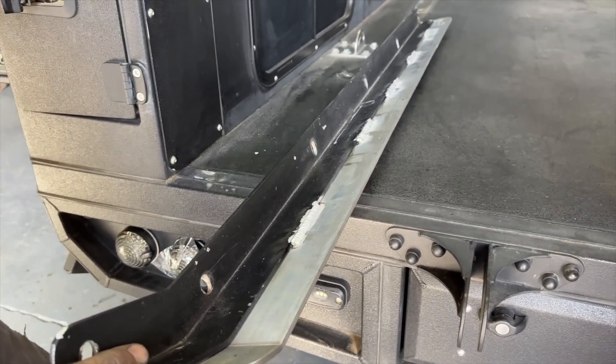Today we're in the Victitech workshop. While the guys are doing a bit of maintenance to the build, I took the opportunity — we're back in Cape Town where I can get all the Land Rover parts — to do our brake discs. This has been overdue. We've noticed on the brake pedal it's been taking a little bit extra, having to push that pedal down a bit further. The brake pads themselves are pretty new. I did a bit of research and found that on front and rear we were a couple of millimeters under the minimum disc thickness required. When you're talking about brake discs, that is quite a bit.